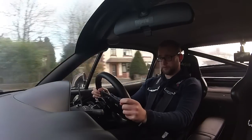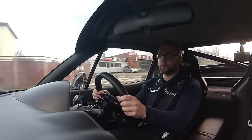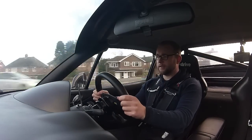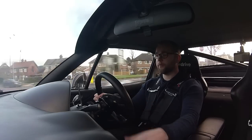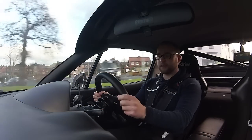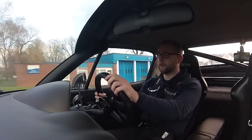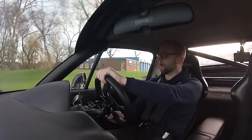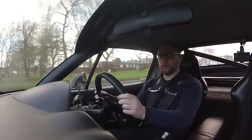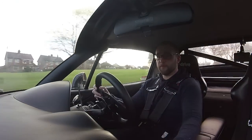If you can take the motor out to do the whole conversion, do so. For me, it made sense because I was doing the clutch and I really didn't like the idea of drilling my sump for the oil return with it in situ, so it just made a lot of sense. Fitting the coolant reroute and organising everything was so easy with it on a bench on an engine stand - it was just a joy. It made the whole thing so much more fun.